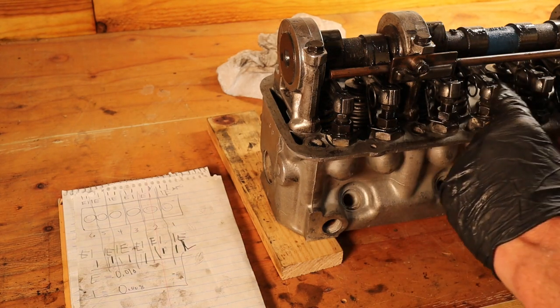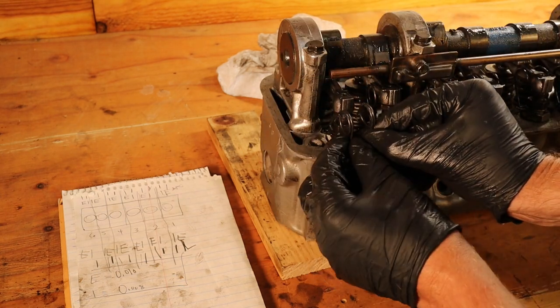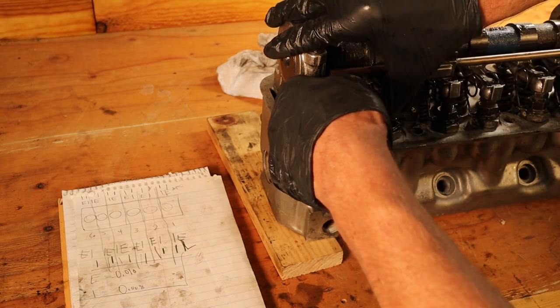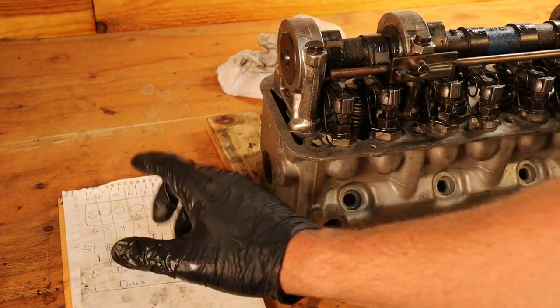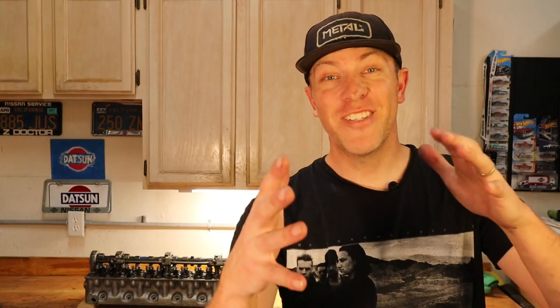We've got everything installed. I suggest putting in each of the springs as you go so you remember which ones you've done — spring on the bottom first, then pop it onto the rocker arm, and always take notes because it's easy to forget the intake versus exhaust and which ones you've done. We finished the head and it is ready to go onto the block — we'll do that in the next video. Thanks so much for watching. If you like what you see, consider subscribing, it does help us out. Also follow us on Instagram at carsbikesandcoffee. See you next time.